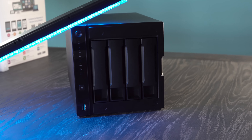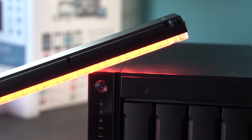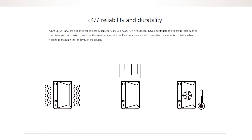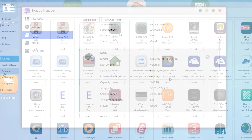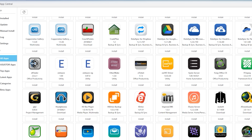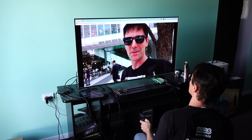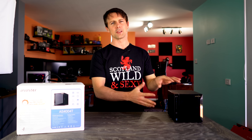There is no wireless built in, so I recommend hooking it up via a switch with a wireless access point connected to that switch. With the AS4004T, I really like the robustness of this device — you can use it as a file storage server, a surveillance camera hub, a Plex media server, or even watch movies directly off it, saving you the need for a home theater PC. I hooked it up to my LG TV and accessed the NAS through the TV's web browser, playing movies with ease. It also has a built-in VPN app and supports live transcoding.